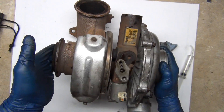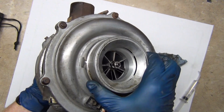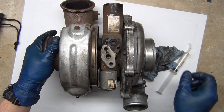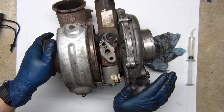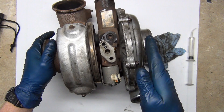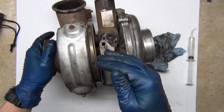It's able to do it faster because we're shoving it — there's so much hot, accelerated, expanded air going on this exhaust side. When it turns this turbine, it actually packs air just like a turbine on a dam, down the intake and makes it so that your pistons don't have to pull. You've heard of vacuum leaks and you've seen a throttle — vacuum on a gasoline engine goes to zero at wide open throttle because there isn't that restriction. With a turbo, you're overcoming that resistance by forcing air down it.